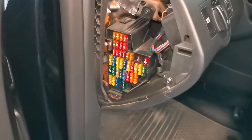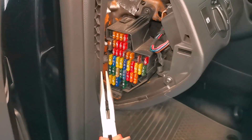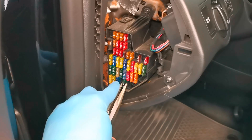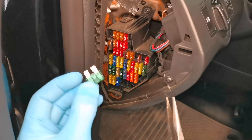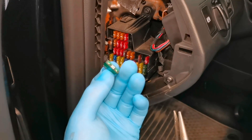The last thing you can do in order to check your fuses is to take a set of pliers like I have here and pull every single fuse out of the fuse box and look at it. Inside every fuse you will see a little part of metal. If that little part of metal is not blown, it means the fuse is good and you can put it back.